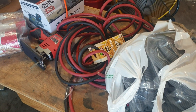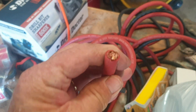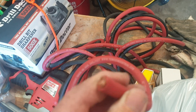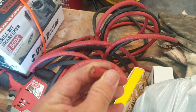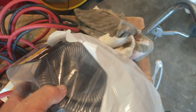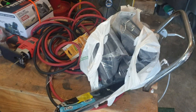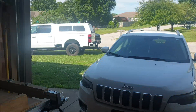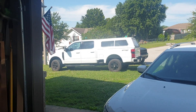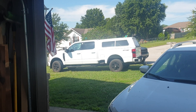I'm getting ready to put an inverter back in my truck. I went on the internet and found some flexible number two copper wire, about 25 feet of it. I'll put some flexible tubing around it — you get 10 feet for about three bucks from Menards — just to keep the abrasion down. I had it wrapped up in my other truck for about four or five years, never had any trouble. I got a breaker for it instead of a fuse — never kicked it.